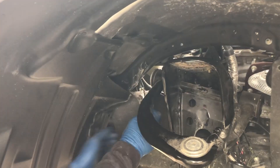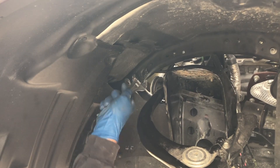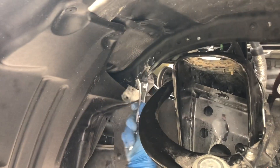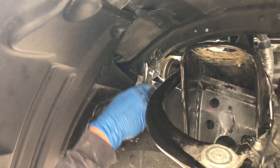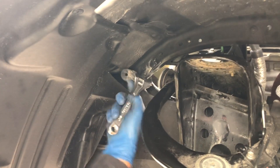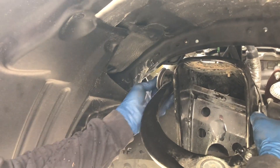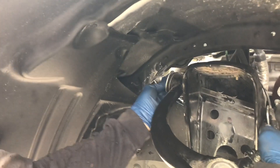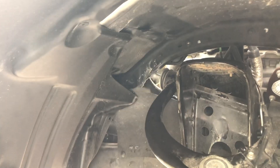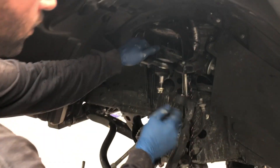What we're doing now is getting the long bolt out of the upper control arm. A little bit of the body is in the way of the bolt head, so instead of cutting it we're just going to slightly bend it out of the way. That gives us room to get this bolt — probably a solid 12 to 14 inches long — out the front. We'll bend it back when we're done. Just move it the minimum amount, and as you can see he's starting to wiggle it out; it'll take some finesse but it'll come out.